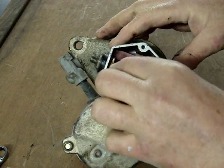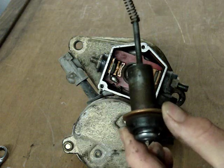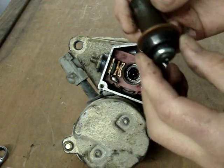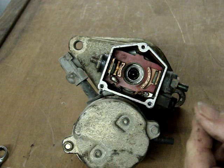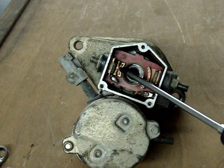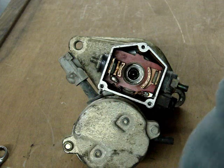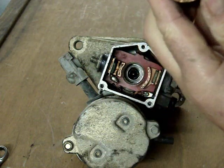This is the solenoid drive, and it's an electromagnetic device. There's a spring on the end. Don't lose track of it. And it has a little contact ring around the surface of it, and then you can see clearly the 2 copper contacts here. There's variations on these. They are different left to right, and usually the Napa stocks all of them.